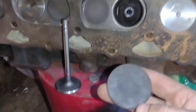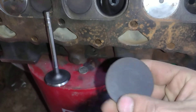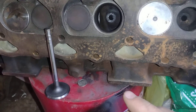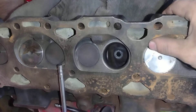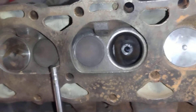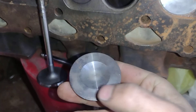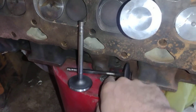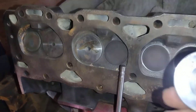So we're just replacing them all. I got the idea — I'll just buy a new set of intake and exhaust valves and call it good. I got Z28 springs, got the retainers, the keepers, everything — good for about 500 to 550 lift, I've heard mixed reviews. I got everything except the intake and exhaust valves. I bought the intake valves, did some research — I wanted to help this thing a little with compression. This here is a 194 valve and it's got a pretty big dish on it.